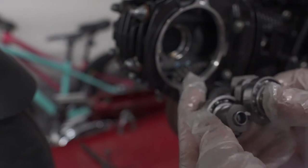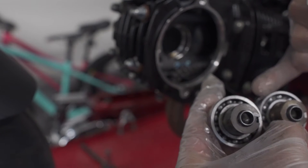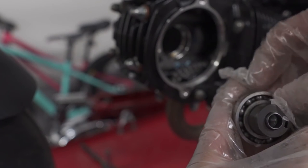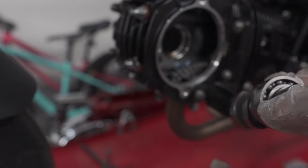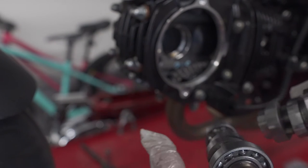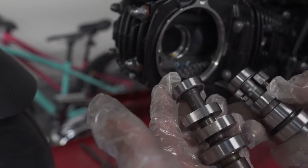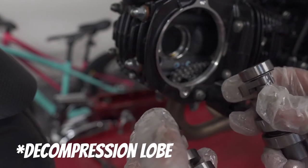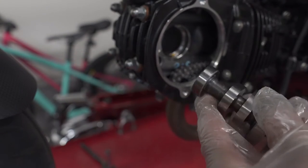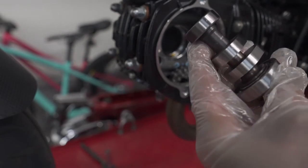Here they are side by side. It's pretty difficult to see, but on the DHM one, this first lobe you can tell is a lot higher. You can see it's coming above the race of the bearing, whereas on the stock one it's below the race of that bearing — so the lobe is definitely taller. The DHM one in my left hand doesn't have — I can't remember what this is called, idle something — but most aftermarket cams don't have this and the DHM one doesn't either. Now that the old one is out, we can set it aside and try to pop this one in.